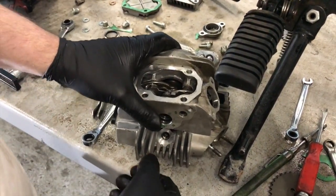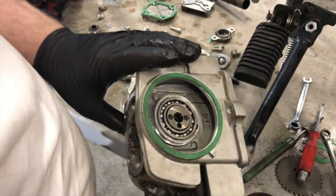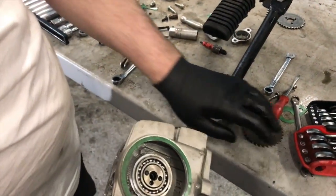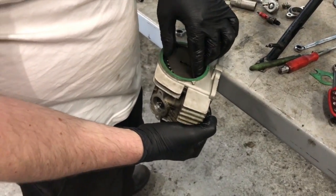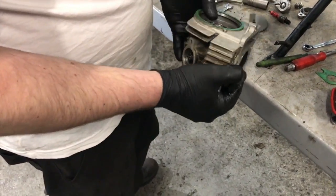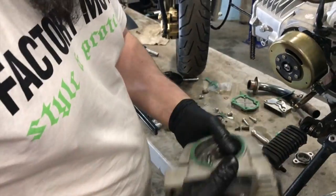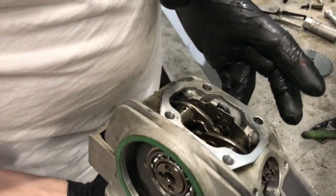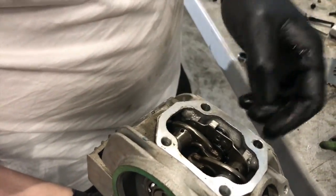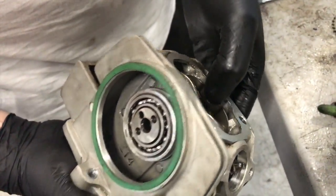Okay, so that's basically the Z40 cam fitted. Hopefully now when we use this pulley, that'll go into there and it'll all be hickety-boo. Like I said, it was a bit of a nightmare actually. Even though it's a big valve head, it still didn't want to take that correct bearing on the back, so we just pressed the bearing off and put it in the other side.